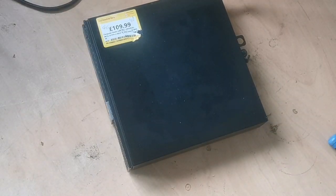And that completes the RAM upgrade, taking it from 4 GB to 12 GB. I hope you enjoyed that. So there we are, lovely viewer. That was taking the Dell Optiplex 3040 from 4 GB to now an additional 8 GB, giving us a total of 12 GB of random access memory.